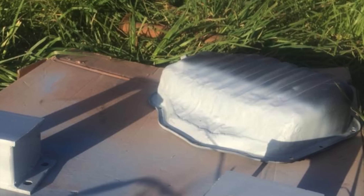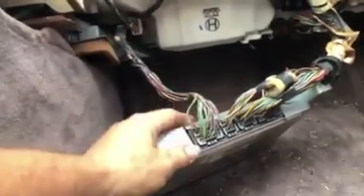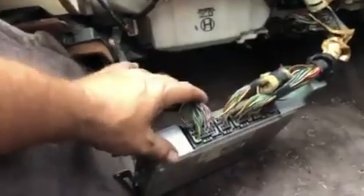For the next step I removed the whole front doghouse in order to get access around the engine so that I could build the engine mounts. Once I had the engine bolted to the transmission in the stock location, I was able to get the engine where I wanted it and then build the engine mount to hold it in the proper location. I also had to notch the oil pan in order to get it to fit around the steering.